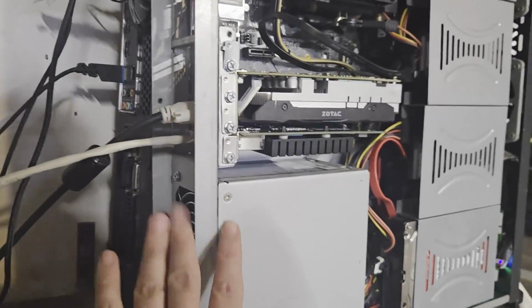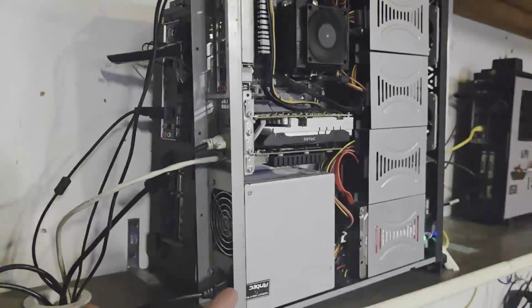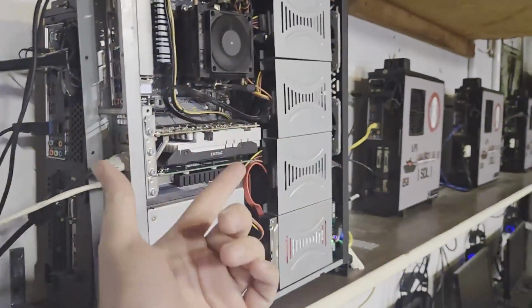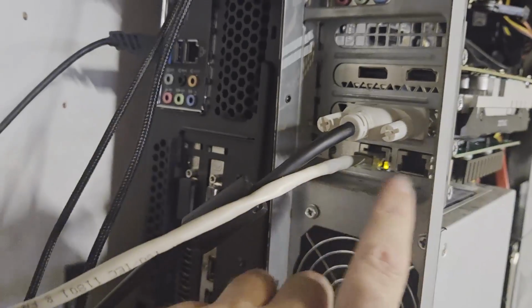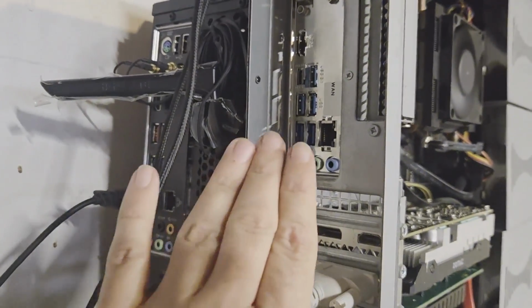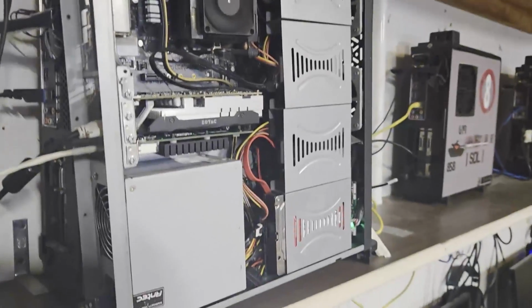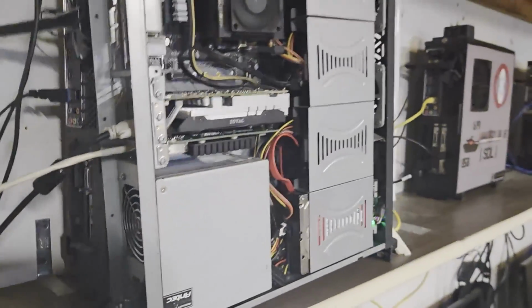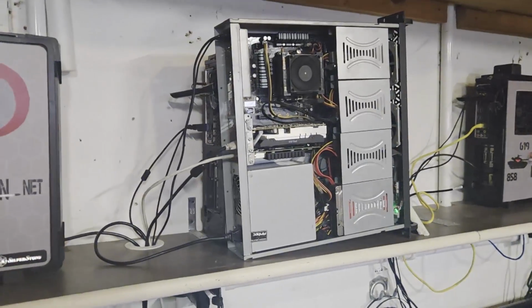Now, I've already installed the 10 gig card into what we call the SDL Blade server. That's going to be our mobile server for Comic-Con as well as the garage server. And what we've got here is two 10 gig ports, and then the onboard 1 gig port we use for WAN when we use this as a pfSense router. And the two 10 gig ports will be on there for either VMs or the system itself.